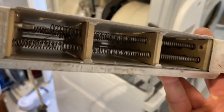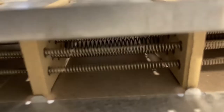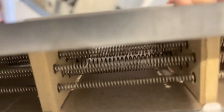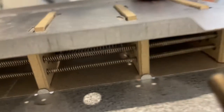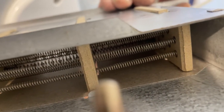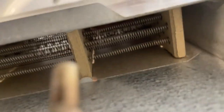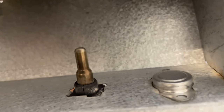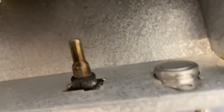If you looked at it from the front it was fine, but if you looked at it from this side, these elements down there - a lot of them were covered in lint, these ones here, all covered in lint. So my guess was that being covered in lint it wouldn't air properly and would cause excessive heat, having one of these sensors turn on earlier than they should, and it would tell me to clear the airways.